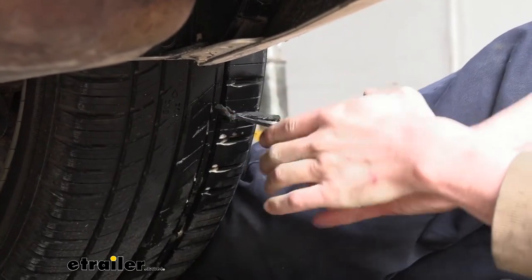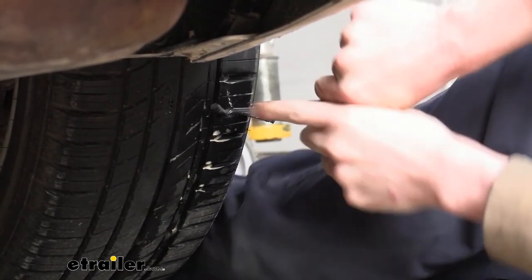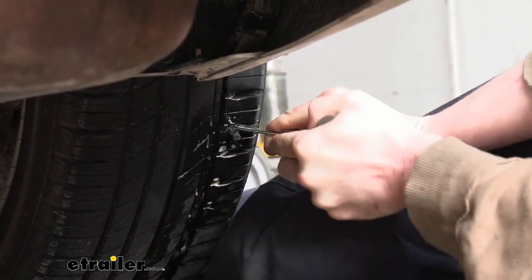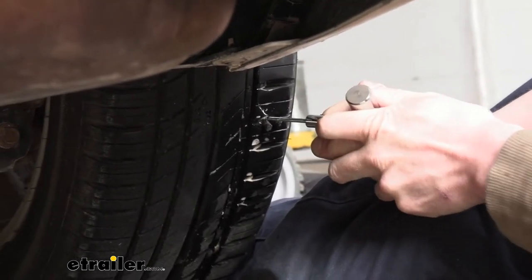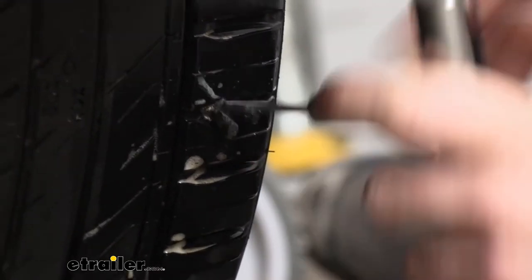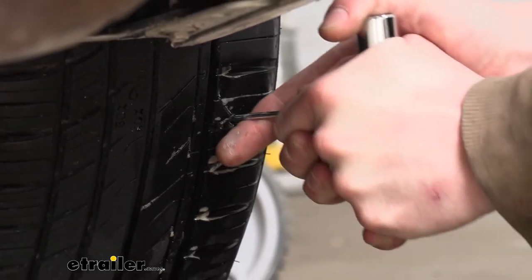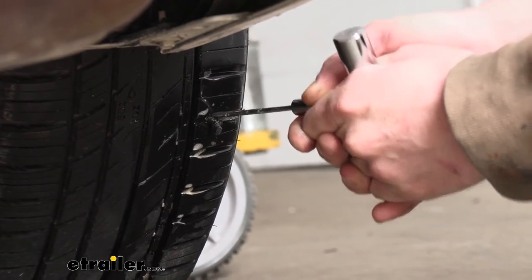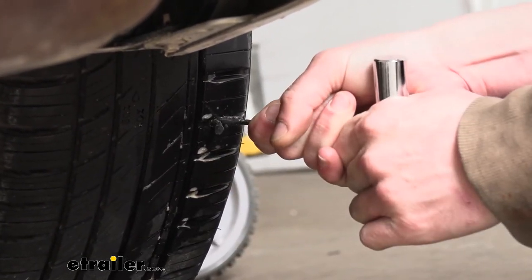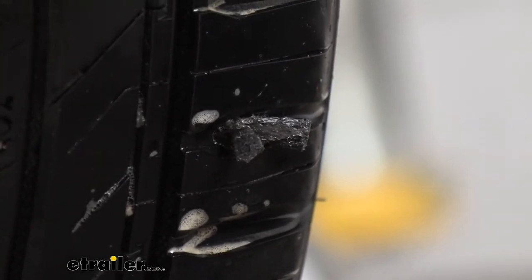It takes a lot of force to push this in. I'm kind of hooking my leg on there so my body doesn't slide away as I'm inserting this. There we go — it's going in. Be careful not to push it too far. That's probably a good depth right there where we know we've got it in, but you've got a little bit sticking out the top. Then we'll just take our tool back out. As you're pulling out, keep an eye on your plug — you don't want to pull the plug out with you. Normally it just slides right out, and it did. If you twist it, sometimes that can cause it to grab the plug, so just try to pull straight out.